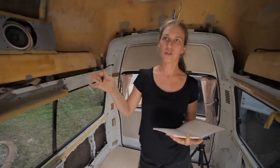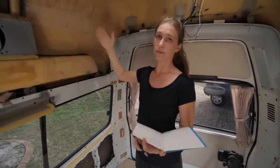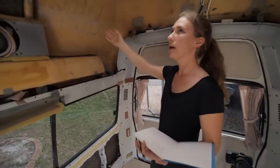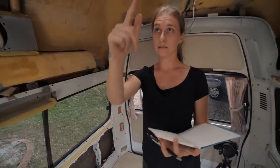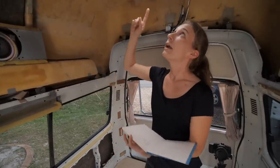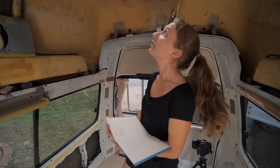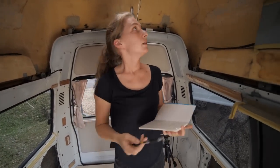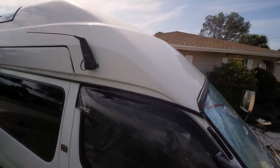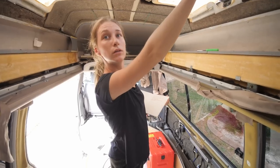So we have a plan of action for the ceiling. We're going to have to bump out the recessed areas of the fiberglass top to all the same level so we have something flush to attach to the whole way through. We'll install some blocking with construction adhesive, and between there we'll add extra insulation. We also have to run our wires before we cover things up — at least the LED puck light wires and our outlet wires. The other thing we have to do before covering anything up is switch out the fan, which already has wiring and a hole, so that should be easy — we just need a day where it's not going to rain. And we should also replace the curtains before we cover them up too.